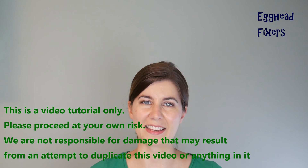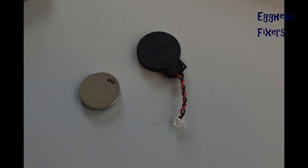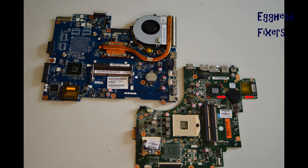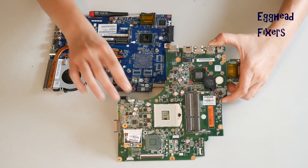Anyway, that's enough talking — on to the repair. Look up a disassembly video first for your make and model of computer so you can locate the CMOS battery. Sometimes you have to disassemble for it and it varies by model, which is why we didn't include it. There are two kinds of CMOS battery: wired and a cradle kind. First we will discuss the wired kind. If you don't have this kind, proceed further down the video where we show you the cradle kind.